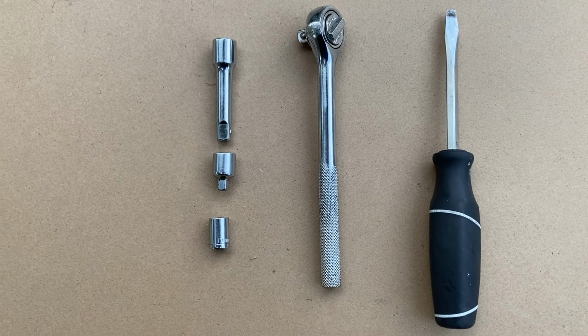To take off the plastic cover, I use a flathead screwdriver, turn this 90 degrees here and 90 degrees on the other side, and then lift the cover. When looking at the engine, the PCV valve is this black item you see here, right above the engine oil cap. The trick here is to find out how to get to it, and it's held here by a 10mm bolt.